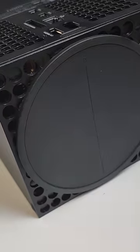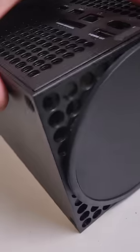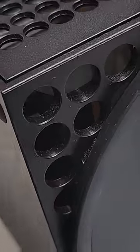Did you know you can remove the base plate on your Xbox Series X without even opening it? You just have to push in on this little clippy bit. I'll show you how. Grab a cloth and a flat-bladed screwdriver, then start at the top corner of the device here where I'll show you.